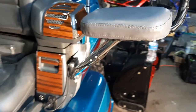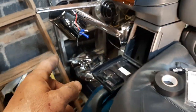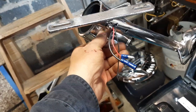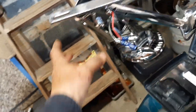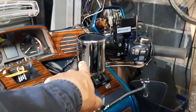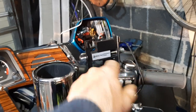It's relatively clean. This is my USB cord — my phone's back here. I did have to remove these screws to fish the wire, just like I did with the cup holder on this side. My top cup holder bolt is above my wiring, but I had to pull the lower one to get the wires past it, and then I'll just push it aside with an awl to put the screw back through later. I'm using the 1800 cup holders on a 1500 bike.